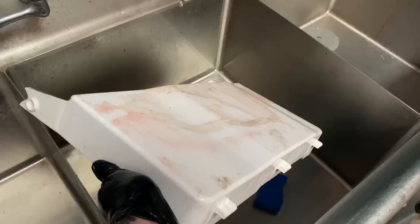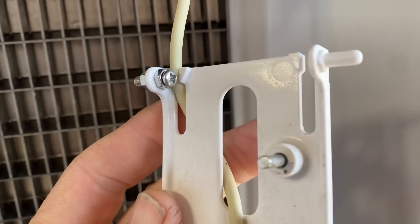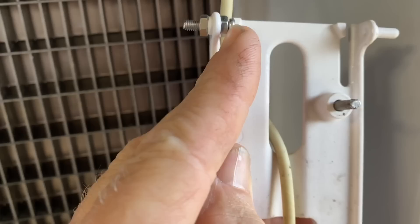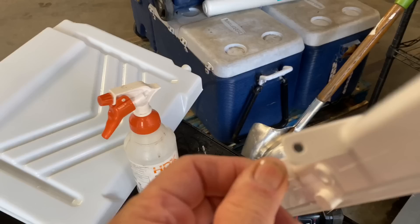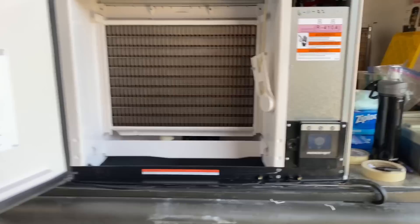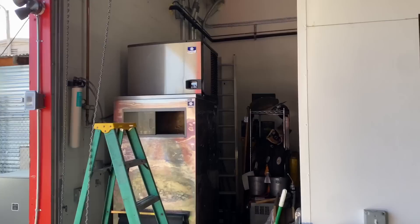Alright, this one's cleaning up really good. I was taking this out and I snapped off one of the pins — which will happen. They're plastic, brittle. Get a stainless steel screw — I got a stainless steel screw with a nut and then another retaining nut, and just make sure that it slides through freely on the bracket. You can get yourself a workaround on those. I can't tell you how many times I've snapped those. Sometimes I'll replace it with a new one, but I don't have one on the truck, so just like a little upgrade. This guy's all tidied up, back to making ice.